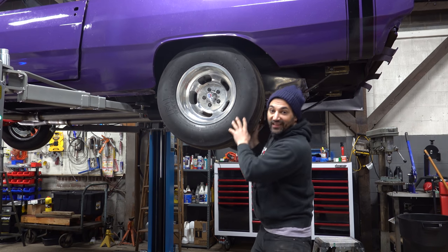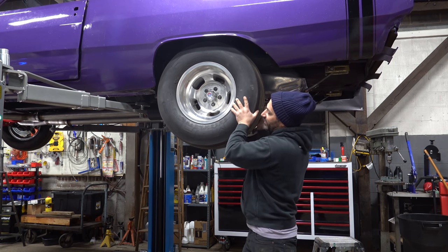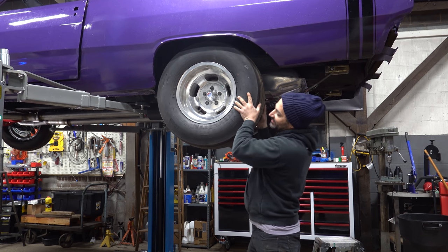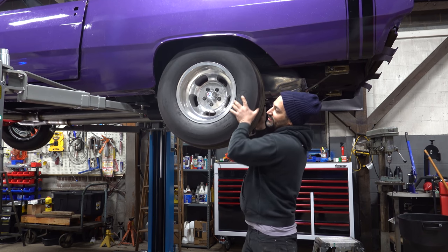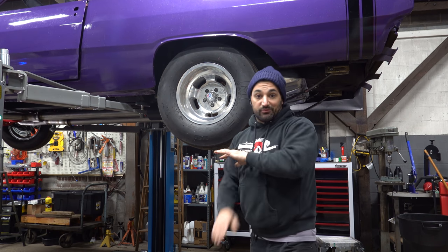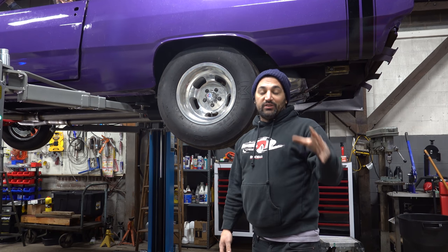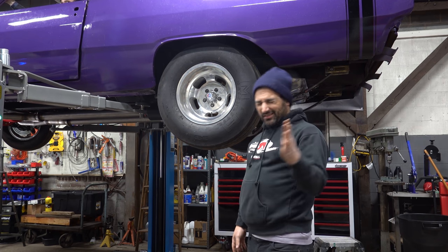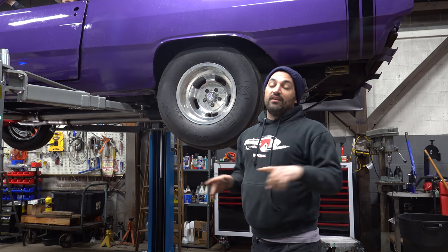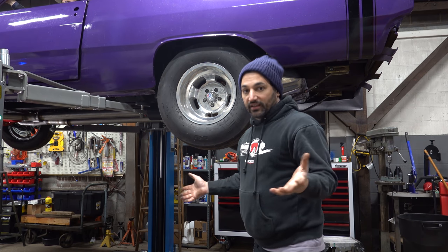We have done this like 40 times. And I never got to move the damn wheel. Alright, up float and a grab. Push down. Seems to work awesome. Now, we're out of adjustment essentially. This is as much stroke as we can give it. So if we do need to get that clutch to disengage just a little bit more, he's gonna have to go up in master cylinder size, which will mean a little bit more effort, but a lot more fluid will get moved. So we've got that going for us.